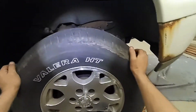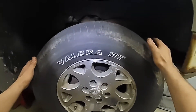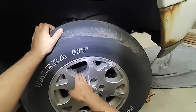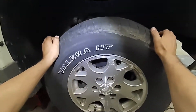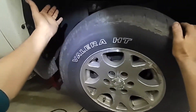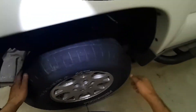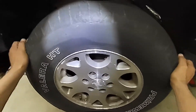After checking the front suspension and steering linkage on this car, I noticed something is wrong with the front brakes. It feels like it has a lot of brake drag — the front brakes are partially locked up. This is a problem because, just like riding the brakes while driving, this will overheat the brake fluid, the bearings, and the brakes themselves, and it will diminish the ability for the brakes to stop the car. It never ends — you try to fix something and you find something else wrong. The left side is actually worse than the right side; this one is almost fully locked up. I can spin it, but that's not supposed to happen.